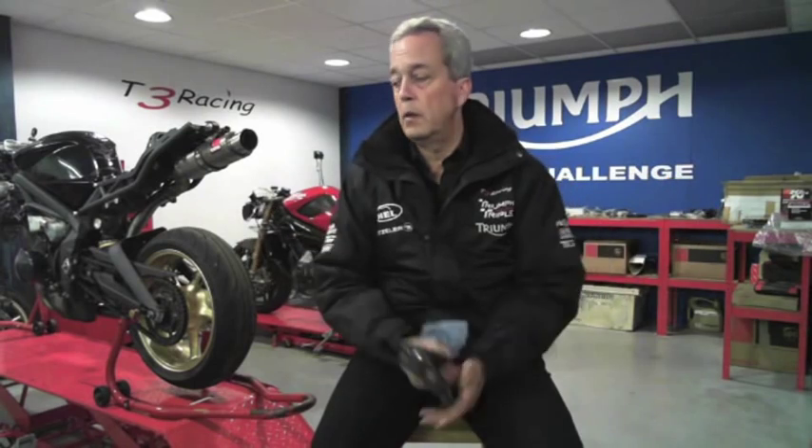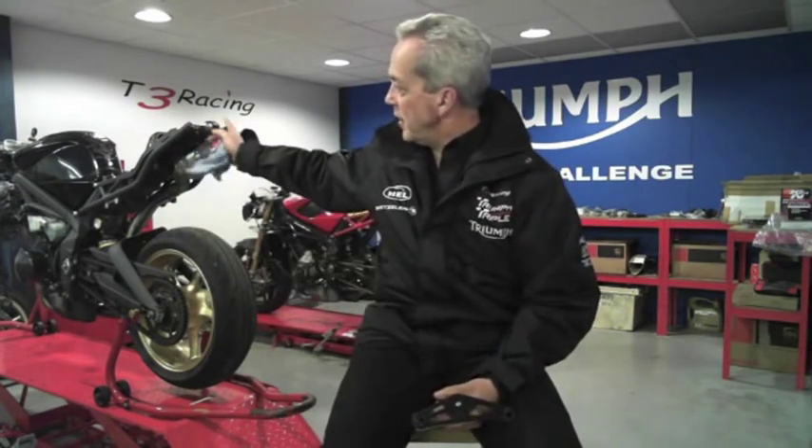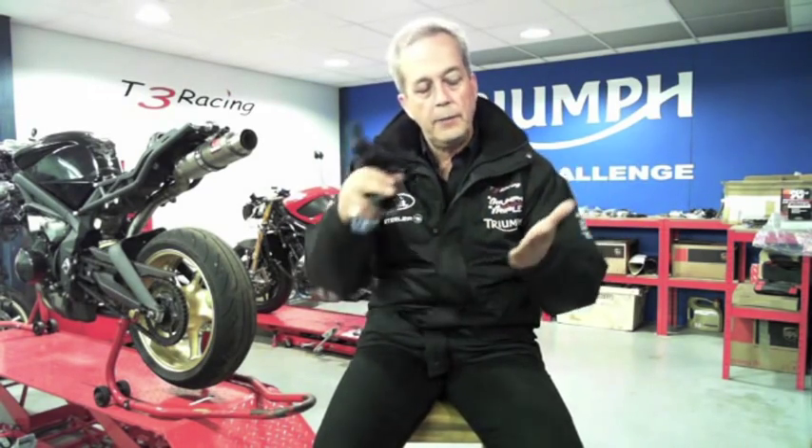Question: do you still make tank protectors? Yes, big ones that go virtually across the full length of the fuel tank. We made them slightly bigger than the tank so you can fill the gap with mastic, and if the tank goes down onto that panel it hits the carbon fibre and the mastic — with a bit of luck it doesn't reach your tank.